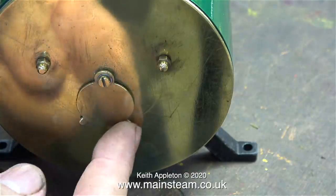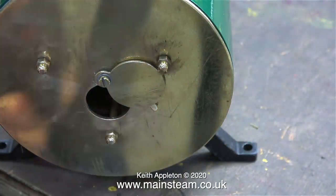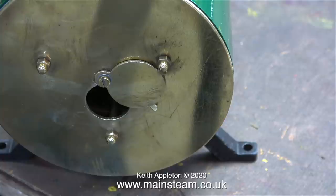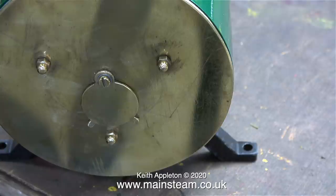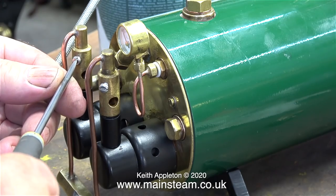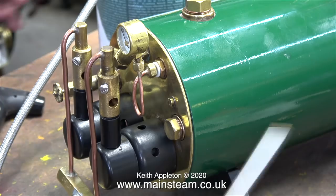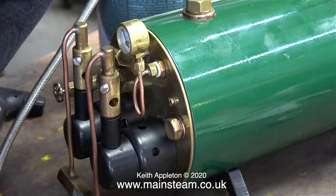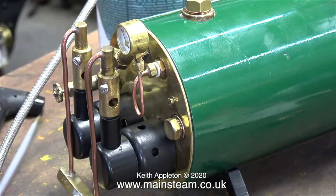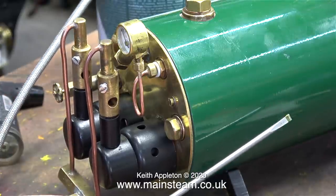I do like this small keyhole facility — this is where you light the gas. When I tried this using Mike Abbott's twin flue boiler, the gas explosion was much louder; it actually made me jump. Gas-fired water tube boilers generally howl, and this was no exception, but by carefully adjusting the position of the jets I managed to eliminate the howl — that's a first.